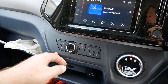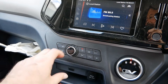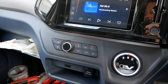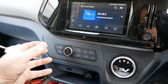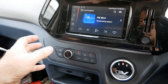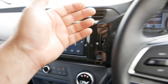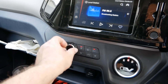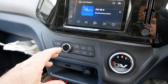That's all good — unlike other electric vehicles where you tend to by default actually get some heat and have to manually turn it down. If you want air conditioning, you press the AC button and then you get air conditioning. At this point it is using the traction battery to power that air conditioning compressor, like all EVs, and you are going to see a slight loss of range. Air conditioning doesn't use as much power as heating, but in the summer you are going to see slightly less range if you run the air conditioning. It's a simple on and off, and then you can adjust your fan speed.